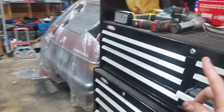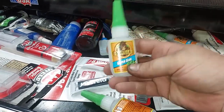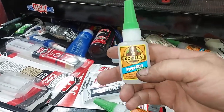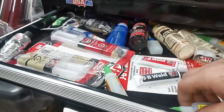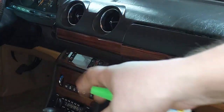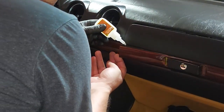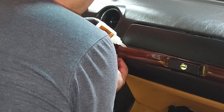While we wait for the oil to settle, let's fix the small piece of wood that's started to delaminate from the dash. The stuff I've tried and found works best is Gorilla Super Glue — but specifically the gel kind, not the runny water-thin type. Because it's gel, when you squirt it in place it won't drip or run everywhere. That's what we're going to use.